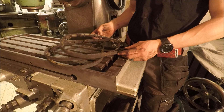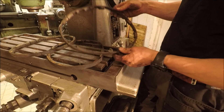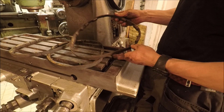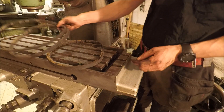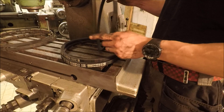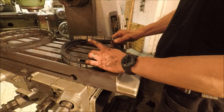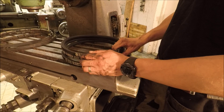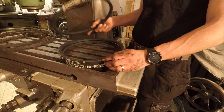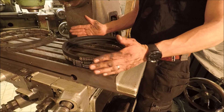As you can see I've gotten the dry belts off and they're not very pretty. I think this is the worst one — it was furthest in the machine and I can't even imagine how it ran, it's just so torn. I got some new belts; I hope these will fit. They are 835 millimeters by 17 millimeters, number B31. I got lucky — I went to a place in Malmö and they happened to have three of those on the shelf, so I just bought them.